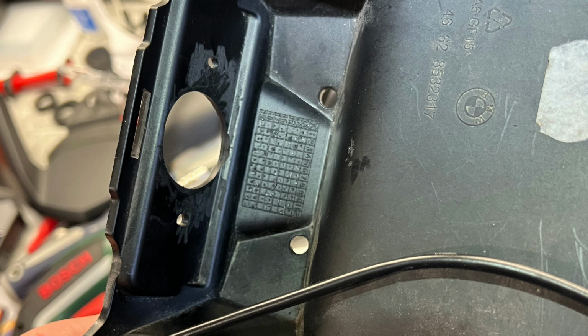Next we'll move on to the rear camera mounting. I've mounted the rear camera behind where the reflector goes in the tailpiece. We'll go on to the reflector area later. When you've got the piece off, remove the reflector with the two M5 nuts and proceed to bore a 30mm hole in the back of the tailpiece.